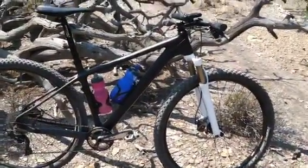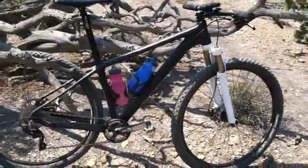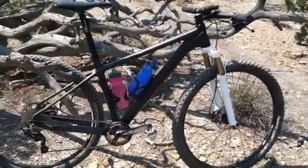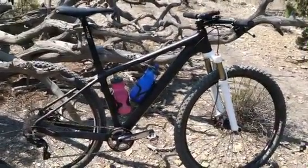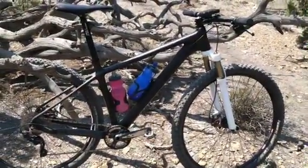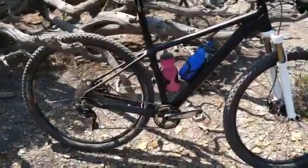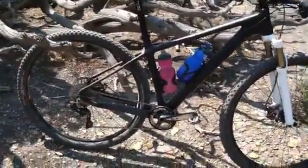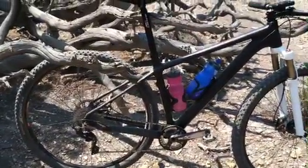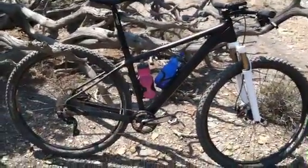So I've since put a Terralogic unit in my front fork. I also dropped the fork to 90 millimeters because I felt like the front end was a little bit slack at 100. So for future reference for others, I'd say 80 or 90 millimeters of travel in the front on an LTK023 is about the sweet spot probably. Also, I found I was getting a ton of chain slap because I was riding things more aggressively, so I've since upgraded the drivetrain to the new XT Shadow Plus, which I like very much, and seems to mesh with the frame really well.